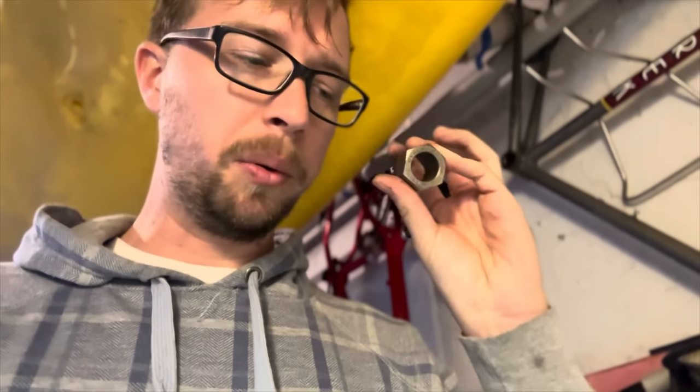The bottom bracket does feel quite notchy. So let's go. Really what we're going to need is leverage. Normally bolting the tool to the bottom bracket, then either using a long bar or actually using the frame as its own leverage works pretty good. So you can throw the tool in a vise if you've got a bench vise and then do it that way. Otherwise, a mate with a long bar or just standing and jumping on it.